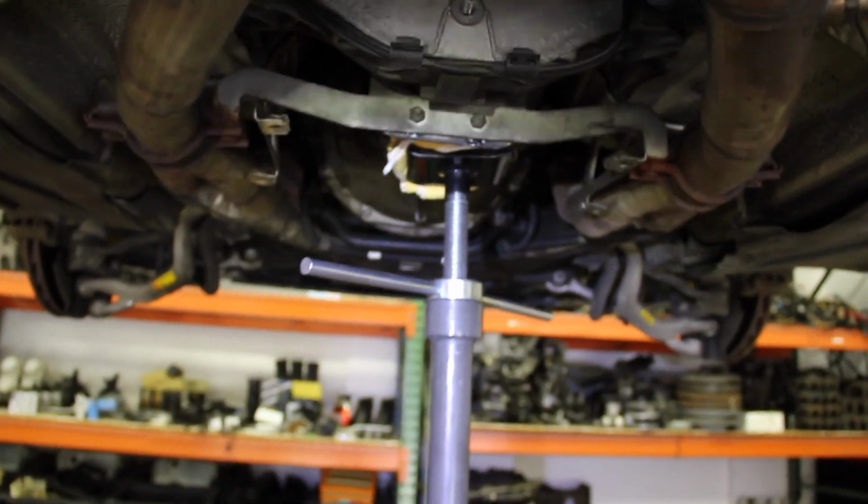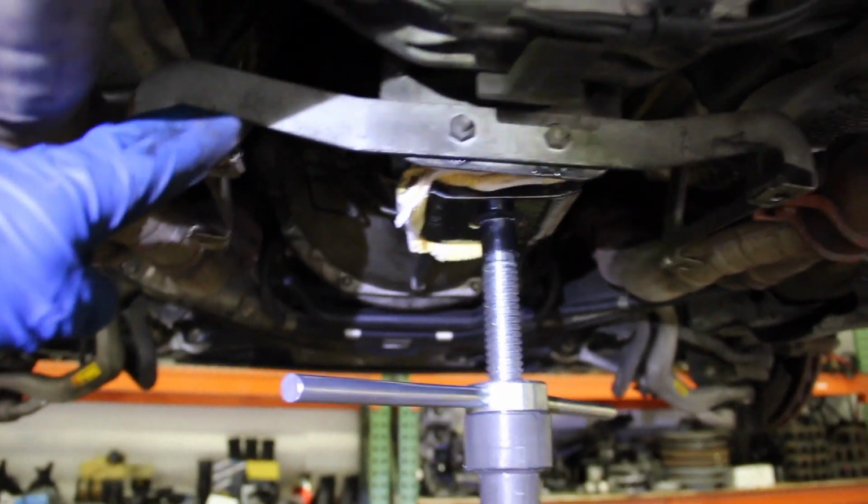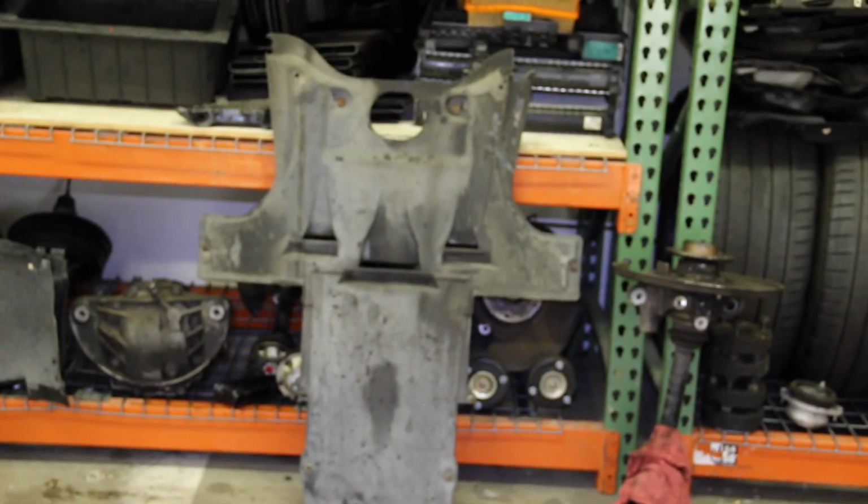And additionally, I already had the transmission pan off this car, the plastic shield that covers the transmission. If you still have yours, it looks like that. It's just a series of 1/4 turn Phillips head screws, 1, 2, and then a couple more. I think there's 4 more up in the front. Release those, and that'll come out of the way and give you access to this whole space.